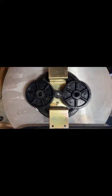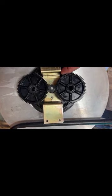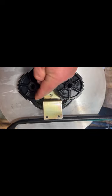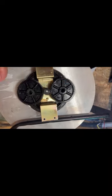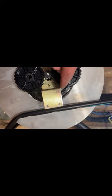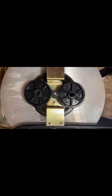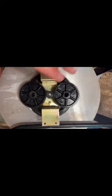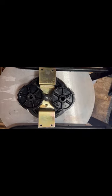Before you put the cover back on, make sure there's an even amount of space between the gear and this metal piece. The cover has two pins or shafts that the big gears go on, which will keep the gears in position. Make sure this gear is not touching this metal — there should be an even gap on all sides. When you put the cover back on it sinks down over the pins, holding everything in position. That's when you put the new rivets on.